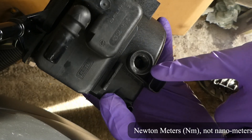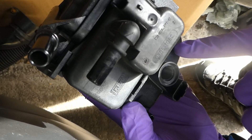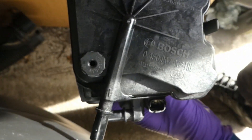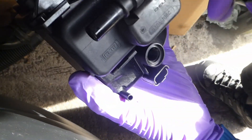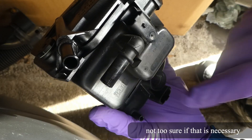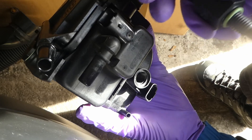At the moment this is not a new filter — well, I've had it for a month, so it's fairly new. It's a Bosch filter; I normally use the Delphi 939. So I'm retrospectively doing this, so it's really full of diesel. I have to draw a bit of diesel out of it so it won't squirt diesel out when I push the sensor in.